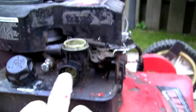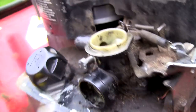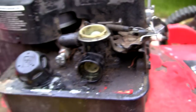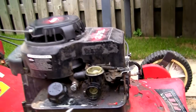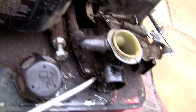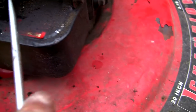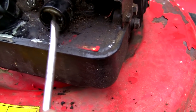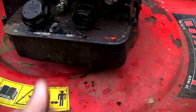I've just dug this old primer bulb out with pliers. To get these primer bulbs out, there are actually two tabs at the sides — you just push them from the side and wiggle the whole thing out. The whole thing comes out and you can replace the bulb, though it's a bit difficult to film. I'm just bending these out from the sides of the little tabs, and this whole thing will pop out. I'm working this around here, levering it out. Eventually it just wriggles out — you see how it's popping out. I'll hook that out and replace this bulb.